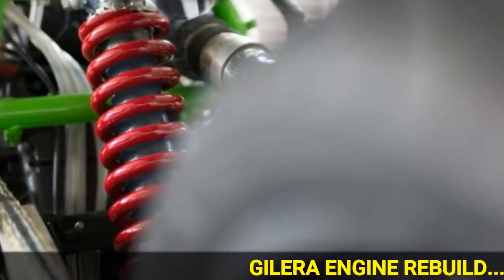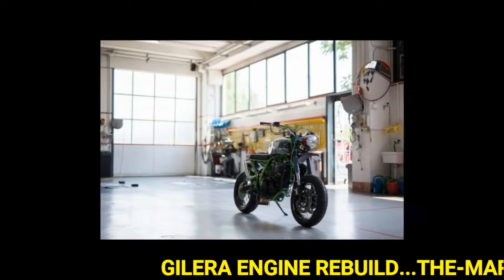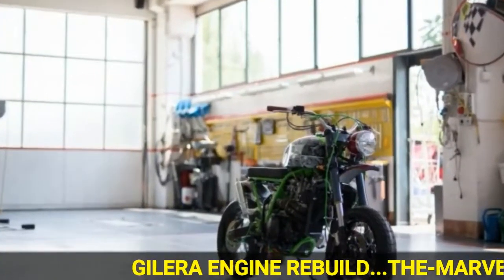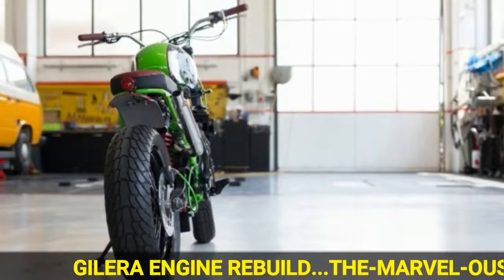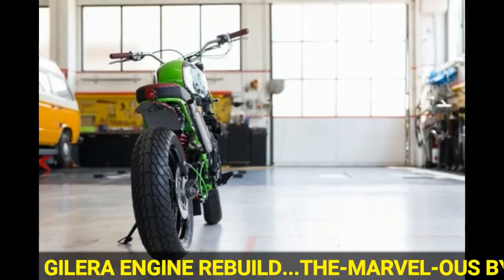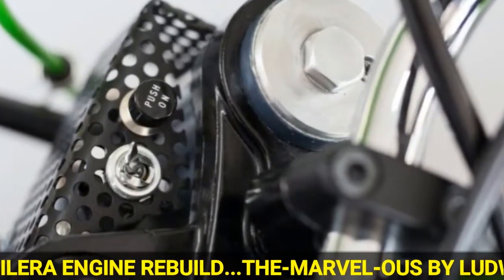The additional stopping power was needed to balance the significant power output increase from the new engine, taking the bike from 33 horsepower to 53+ HP. Due to the fact that the bike was built with a more direct road-going focus, the oil in the forks was swapped out for a replacement with higher viscosity, and a new piggyback Voghera monoshock was fitted in the rear.